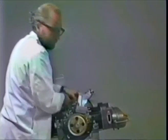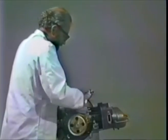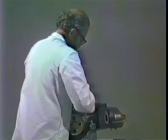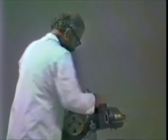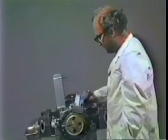Incidentally, you guys that do have 356 and 912 Porsche engines, the Maestro's database of over 2,000 engine numbers, engine ID number, case casting number, type number, and the date stamp that we showed you on the inside of the main case halves is very important. It correlates to the internal parts and when they made important changes in the internal parts, and that way you can tell from external numbers what internal goodies your engine has inside. So I'd really appreciate it if you'd send in your engine ID number, case casting number, type number, and if you do have a car, then of course your chassis number. From the database, it's now so good that we can get down to the fiscal week your engine was made simply by looking at any of the ID numbers or the case casting number. And we'd also tell you what all the internal goodies are in your engine.